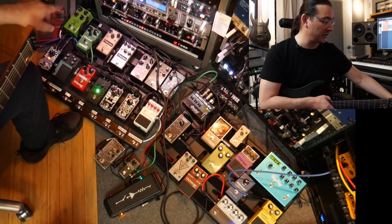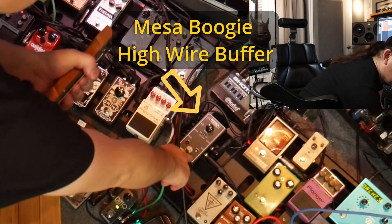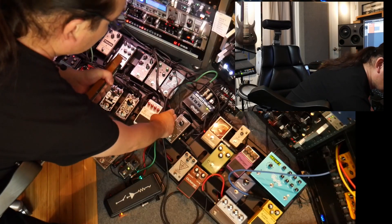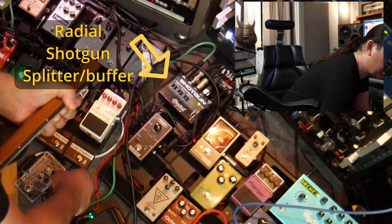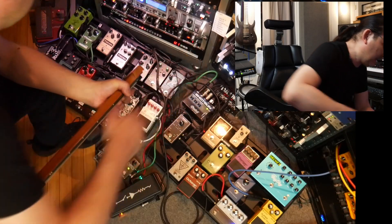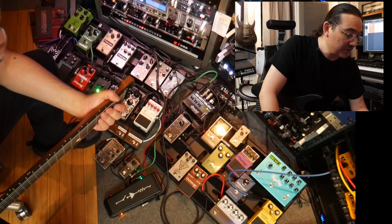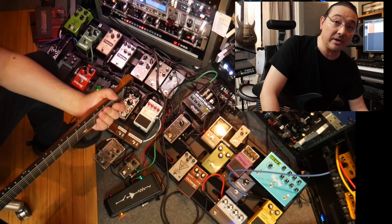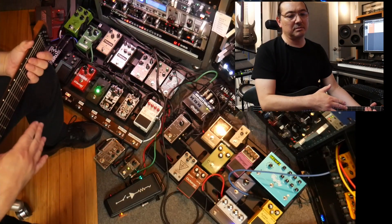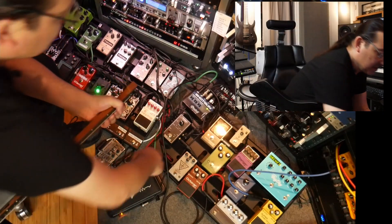So eight amps and eight cabinets. Right now I'm just using the Torpedo Studio, and I'll talk about that in a little bit. But let me show you the routing here first. The guitar goes into this High Wire buffer here, and the left side of the pedalboard is hooked up into this loop. On the tuner out I'm sending it to this shotgun guitar splitter, which goes to the tuner and triggers the gate at the end of the pedalboard, as well as a direct out — two direct outs. One goes out so I can hook another amp separately, and the other goes to the preamp for a direct in. I usually record a direct line as well as the amp in case I want to re-amp or trigger something.